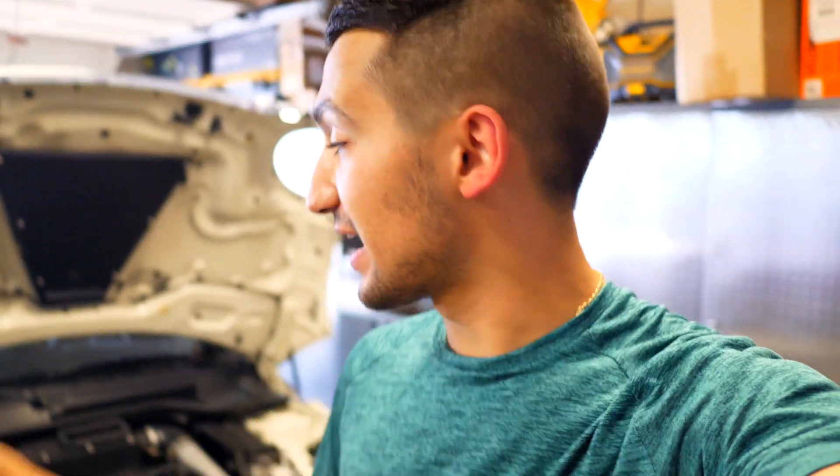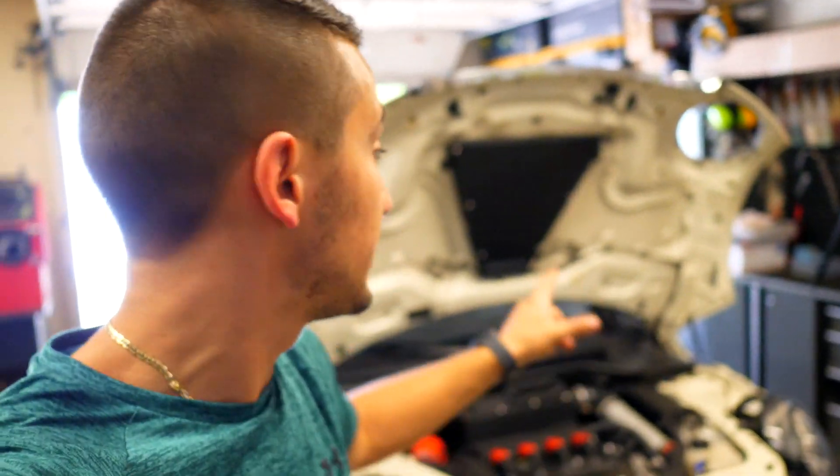Welcome to another episode. Today we're working on the Mini. We have the forged engine built and up and running, and we're almost done the secondary break-in stage — about another 150 kilometers to go before I can switch to synthetic oil and a normal filter. Once I break in those extra kilometers I'll be able to beat on the car. What we're doing today is changing out the tune — we currently have the OEM tune, and there's a sport mode option that changes the map and gives a bit more boost, but because we have totally different internals we can't utilize that, so I'm upgrading to an RPM tune.